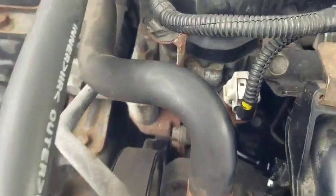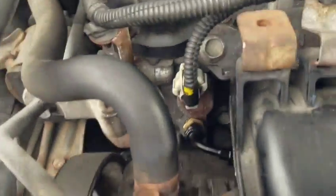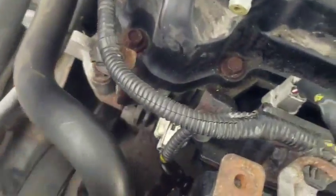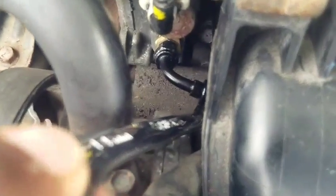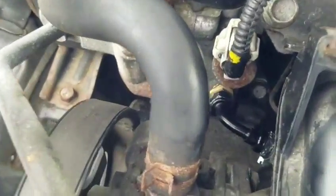Once you get it in the hole, you tighten it with your handy dandy 15mm and make sure you tighten it till you can't go no more. That's what it looks like fully tightened in. Now when you tighten it, it's going to tend to turn down. So what I did was I took this 14mm wrench and put it right under it just like that — held it there while I tightened it so it never went down. That's it, fully tightened.